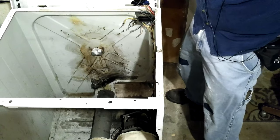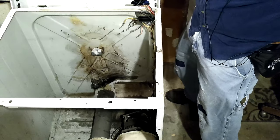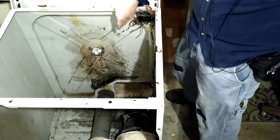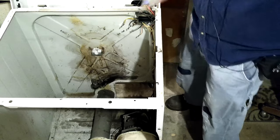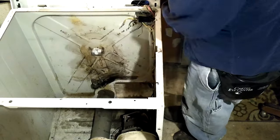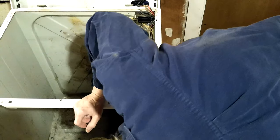I believe the one that goes in the heating backing plate is the high limit thermostat, and I have already tested them all. They're supposed to have continuity when they're cold, and they do. I think I'll do it when I'm thinking about it, because every time I put it off I end up not doing it.